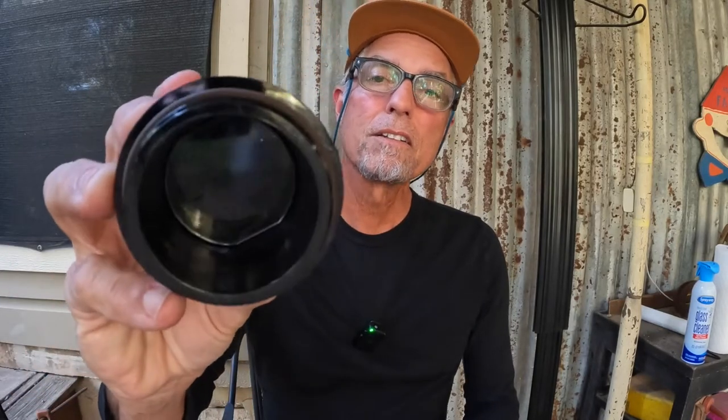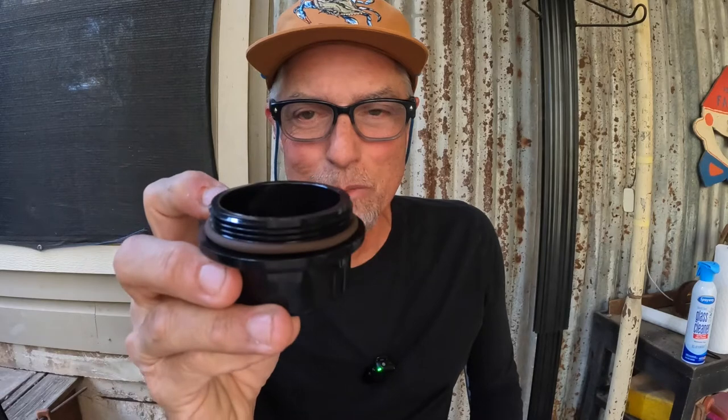Threaded plastic. I think you can find threaded metal. But here's the mistake people make. I saw in a video already that a guy puts on this threaded plastic, then he goes and gets a pipe wrench and tightens the thing down to where it smashes the O-ring right there. The plastic. Hand tighten it, and then some, by hand.